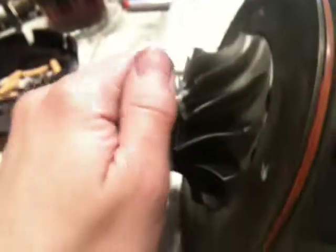You're basically going to take the 14 millimeter, put that on the exhaust wheel, then take the 12 millimeter and put that on the nut for the compressor wheel, and turn them in opposite directions to unscrew the nut.